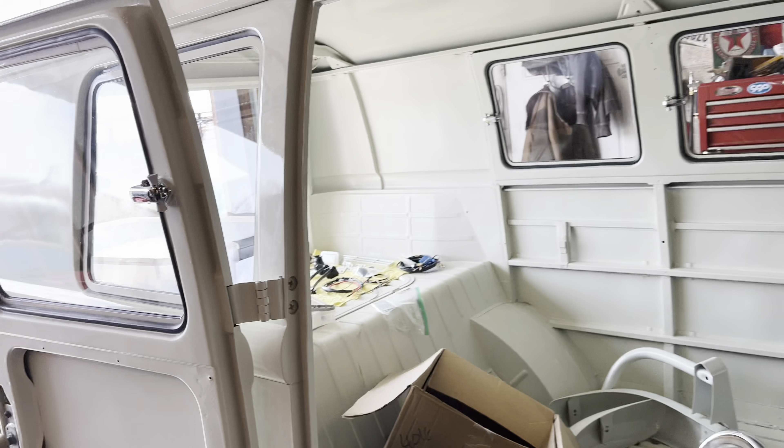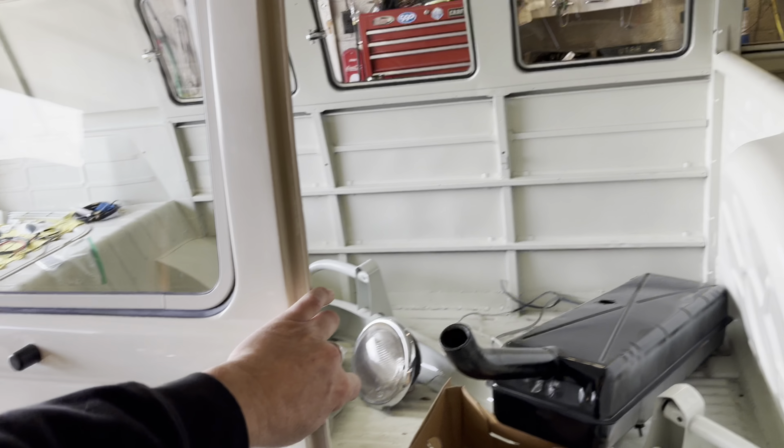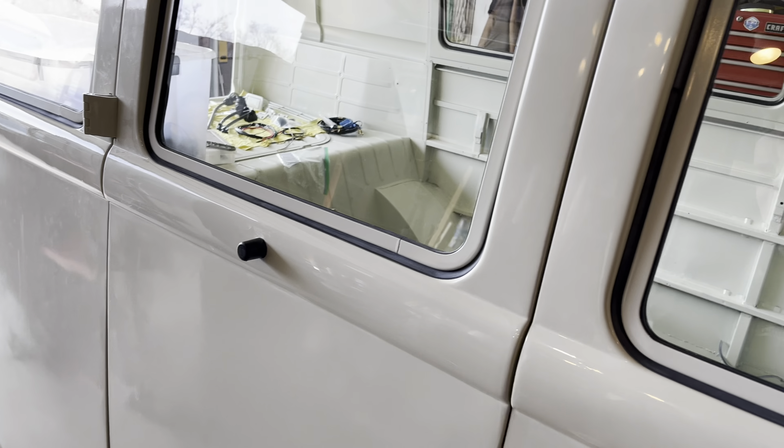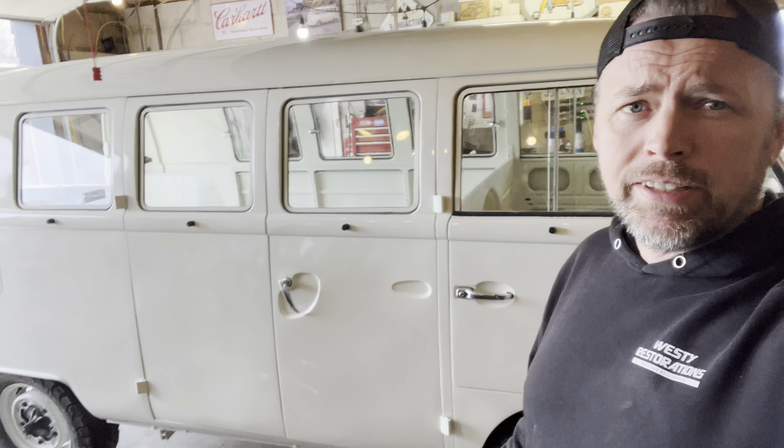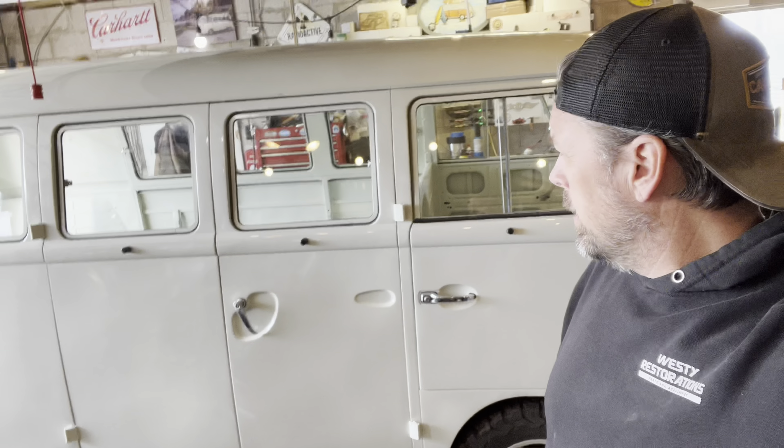And there are the rest of the windows. I'm pretty stoked with it - it's starting to look pretty good. I got this bus a few years ago, it was completely sandblasted. All the window frames had been taken apart, they came in pieces. Some of the tabs where they went together were broken - I had to weld those, tap them, and drill them. So I didn't think these windows were ever going to get done for a while. Kind of a big deal for me. Big day. Pressing on to the next thing - I've got a rear safari to do, front safaris. There's always something. All right, see you next time.